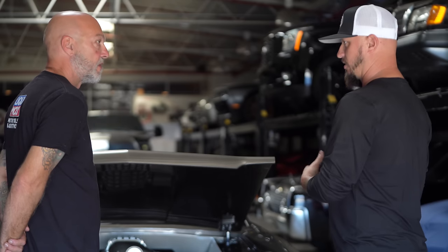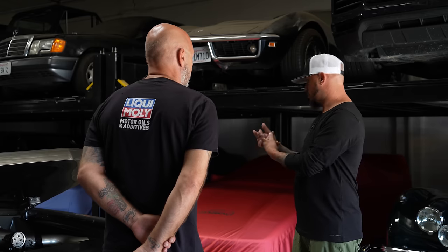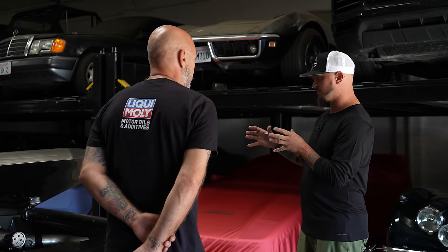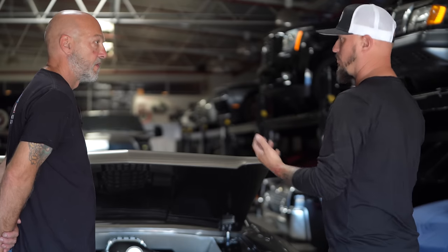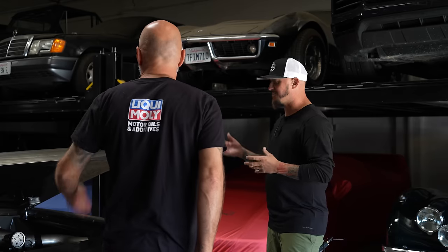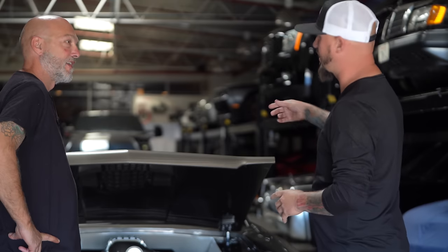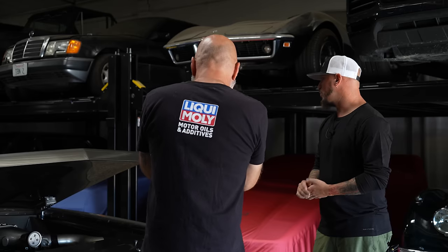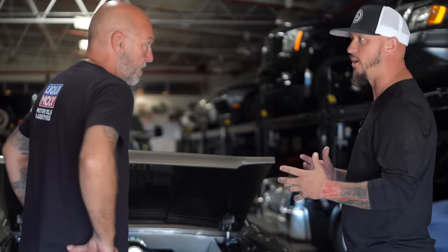Yeah, all the master cylinders are underneath the dash, and it's all cantilever, right? Because there's not a whole lot of room under there for two brake master cylinders and a clutch master cylinder. So we built everything on a cantilever basis, and the ratio that we did is amazing. You can get in and hit the brake and the clutch, and it's so soft. Right on point. And so probably a bitch for serviceability being under the dash. You know what? The whole top gauge panel is all held on with magnets. You just literally lift it off. We thought about all those small little things, and I think we thought things out very well.